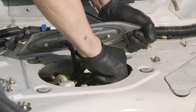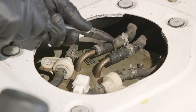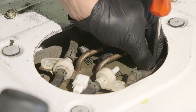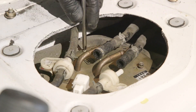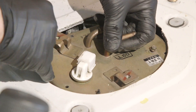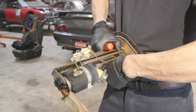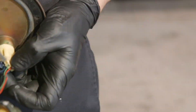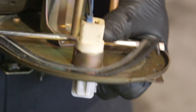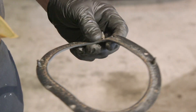Our first step is to remove the car's interior to access the fuel pump cover. Next, remove the OEM fuel feed and return lines from the tank top plate. You might also want to move the fuel tank vent lines from the top plate to get them out of the way. Now remove the Phillips screws holding the top plate to the fuel tank. With the screws removed, the top plate can be lifted from the tank with the OEM fuel pump and fuel sending unit underneath it. Unplug and remove the OEM fuel sender unit from the fuel pump hanger — this is the only OEM part we'll be reusing, so set it aside. Remove the top plate gasket; you can reuse it, although since the FD is an old car we recommend replacing it while you're in there.